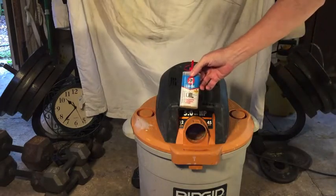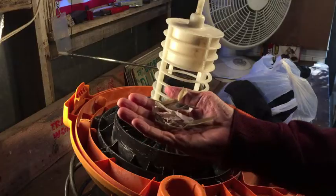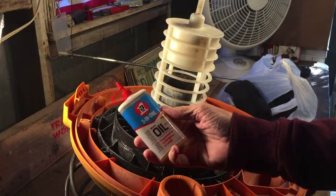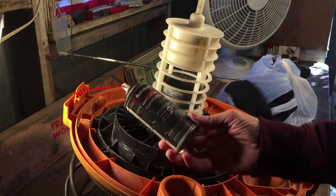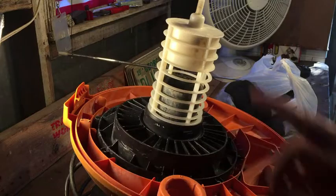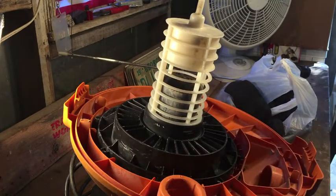The only thing I smell is 3-in-1 oil. I cleaned the trash out of the impeller, lubricated both sets of bushings or bearings using 3-in-1 oil, and cleaned the commutator using anti-corrosive lubricant spray and 220-grit sandpaper. And that led to this improvement — here's before and after.